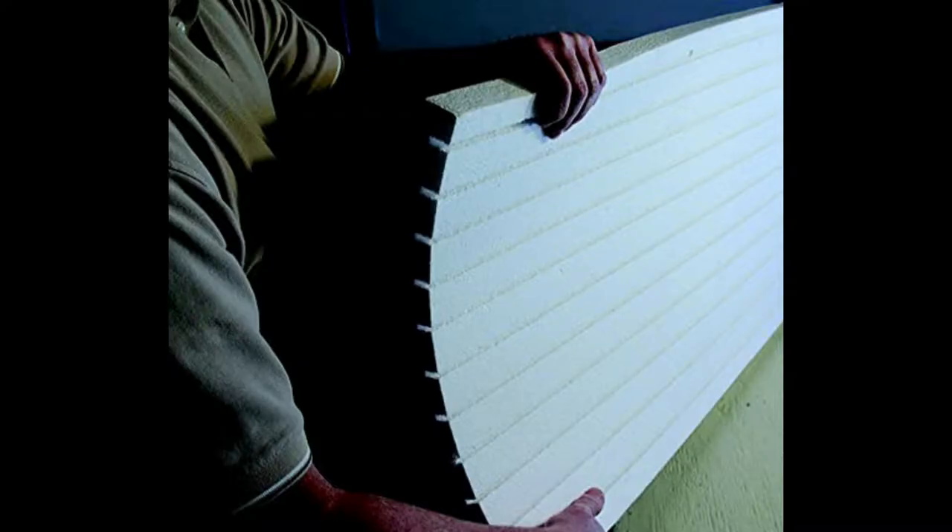And this next one is Insul-foam. It's got an R4.8 insulating factor. This may not seem conventional, but after I got to looking at it I thought I might give it a try. It's normally used to insulate the inside of a garage door. It has a firm face to it, and the underside has ridges so it's really flexible. This may work to totally insulate the van walls, or maybe just the roof. It doesn't say anything about being resistant to moisture, so if I use it I'll likely need some kind of moisture barrier. I went ahead and asked on Amazon to see if anybody knew the answer to that.